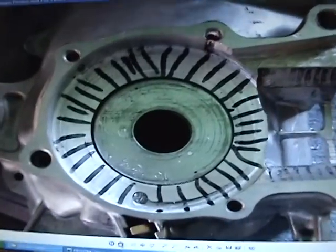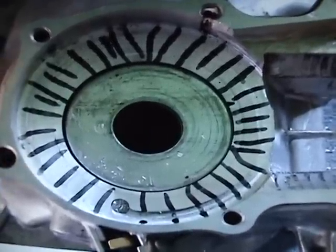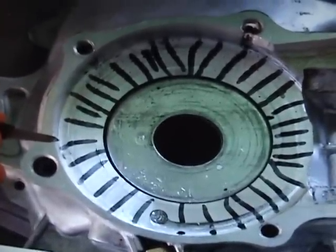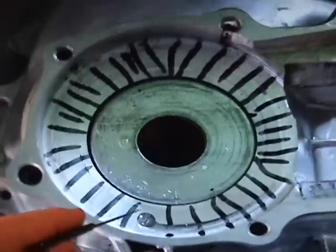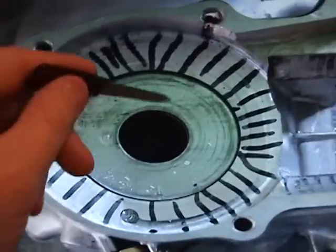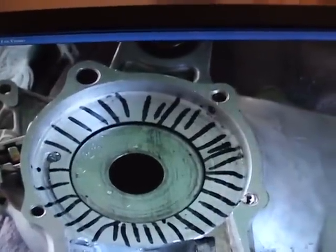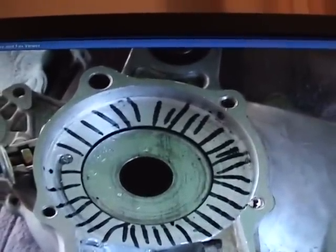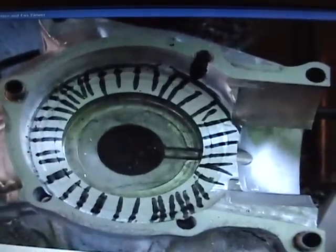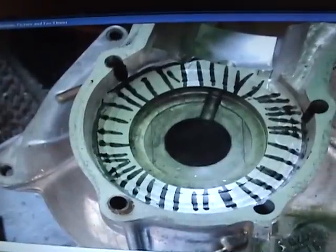Very good people. Now when I got close to where I wanted to get, I would take my calipers and push them down into the base here and up here and down here and check how many hundredths I'd have to go. I started to use a blocking method, which I use an ink pen for right here. The ink pen just lets me know where I've cut and where I need to cut, because I'll run the cutting bit over the edges and it will show me where I've cut, because your eyes sometimes can deceive you on that.